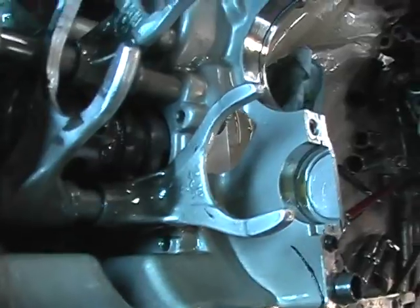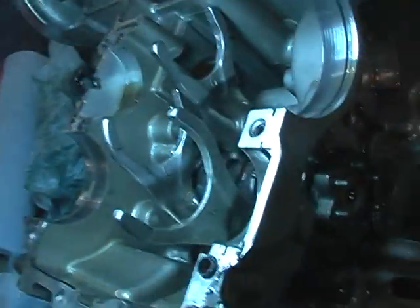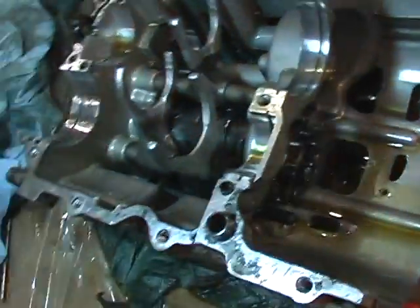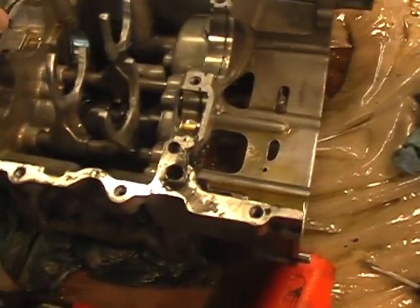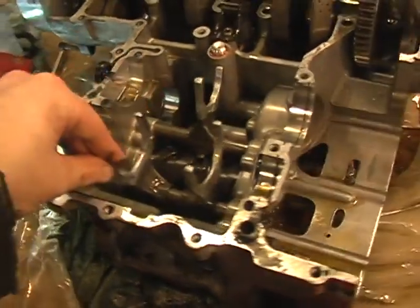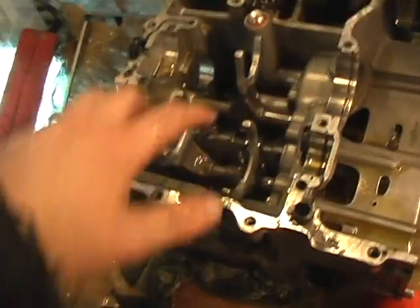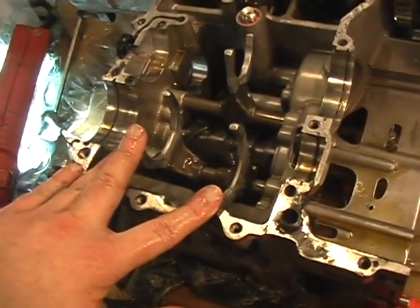The other forks don't appear so bad — a little rubbing here and there but really not much to report. So I think I'll probably leave them and give it a go. I don't have any parts ordered yet — I took this all apart just to see what parts I needed. I'm going to take out the shift drum and we'll see how that looks.